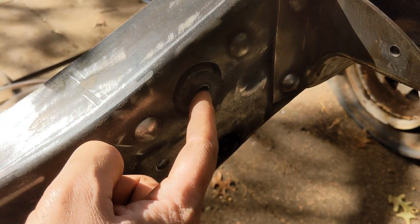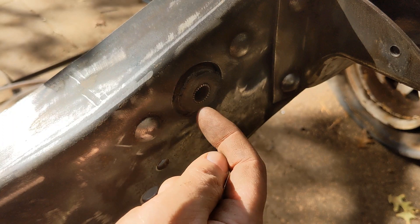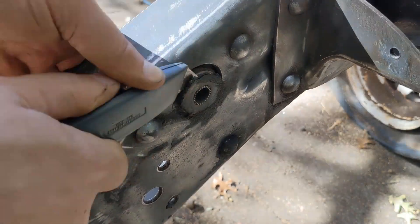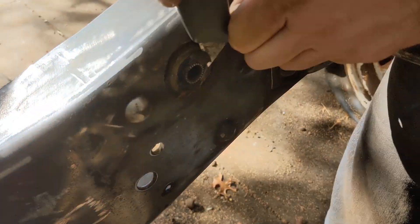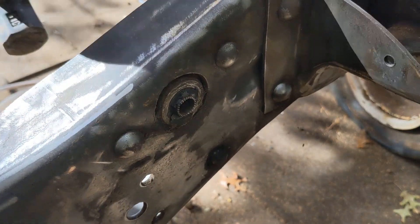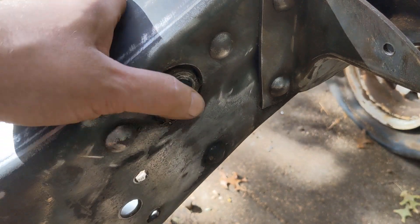In some cases, this centerpiece is one solid piece of metal all the way through the bushing, so you can't drive it out when you try to hit it — the rubber just basically absorbs all the impact. So what I'm going to do is use something to cut the rubber around here so that I can get a hold of it. This thing doesn't want to come out; I'm going to try the air hammer, and if that doesn't work, then we'll go with the torch.